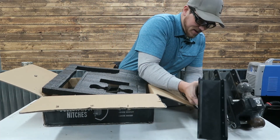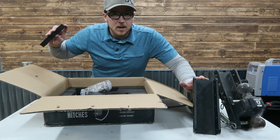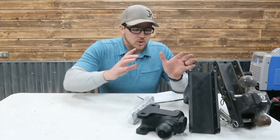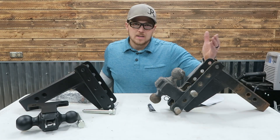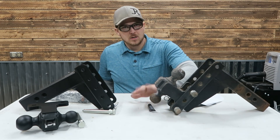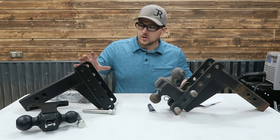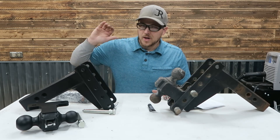Oh, this thing is so heavy. I will say Bulletproof did a great job on the brand naming and marketing — there's no better term to describe their products than bulletproof. This is so heavy duty, so overbuilt. On this one I went with a four inch drop hitch instead of a six inch. On my truck the six inch drop hangs down a little too low, and with the lower ball position when you flip it over, the six inch was already too low. I remeasured my truck and trailer setup and determined that a four inch drop was going to work.